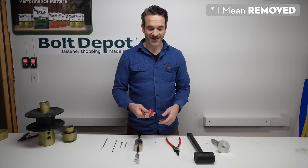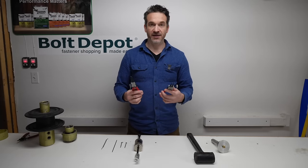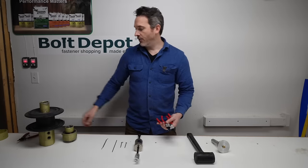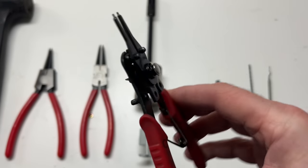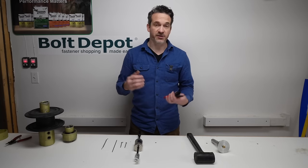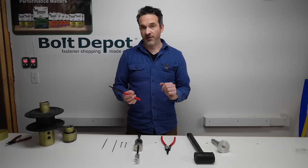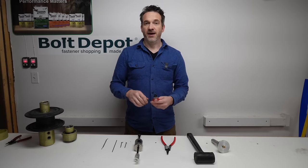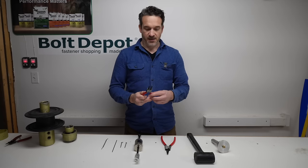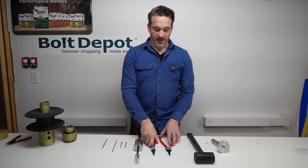After you get the oil seal exposed you're going to be looking at some snap rings, so you'll want a pair of internal and external snap ring pliers. I highly recommend that you get a dedicated pair — these ones have jaws that do not warp. If you try to get away with a little combo set, that's great on small parts, but the snap rings in these are 50 millimeters and 80 millimeters and they're under a ton of tension. You will not be able to reach a lot of them, and if you can, the part is going to spring out and flick around, leaving scratches and damage to all your surfaces. These are nine inches and they're the minimum size you'll want for this job. I would probably be happy with a set of 12-inch dedicated snap ring pliers.